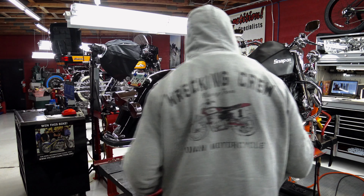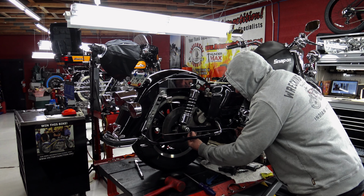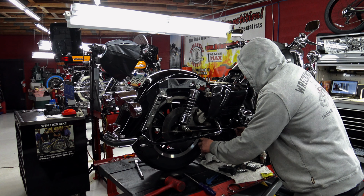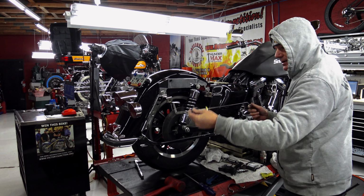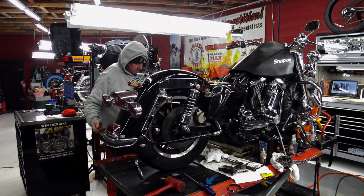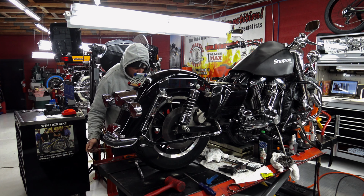All right, tires in. Now we're going to make sure we have proper alignment on these earlier year bikes. Without the little hole drilled in the swing arm for alignment, you do it off the pivot shaft, and you make sure everything's aligned. Use that little tool here for alignment. Go to the other side. And that is right on the money. You can't get any better than that.